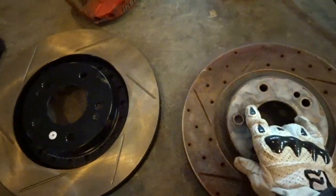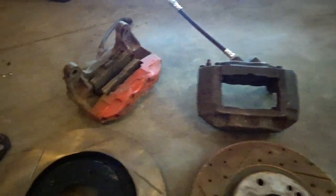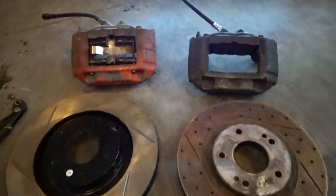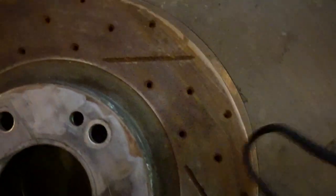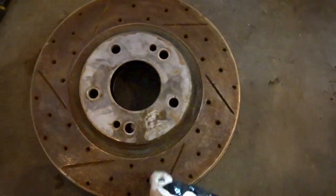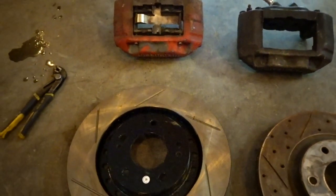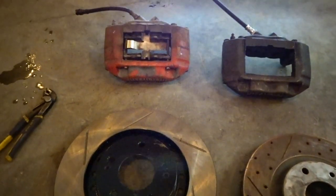These are the old rotors that were on the car when I got it. These are the calipers. I don't know if the guy before me upgraded the calipers to the 99s, or if Dave sent me 91s — I really just don't know, because they're the same as that caliper. There's nothing different about it. But this rotor for the 99 is a little bit bigger — just barely. Not even a half inch all the way around. I went off what Junkyard Dave said: he said these are 99 calipers, so you're going to have to get 99 rotors because they're bigger. Which made sense, because they are.